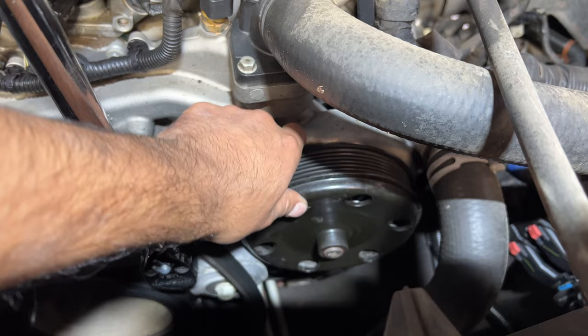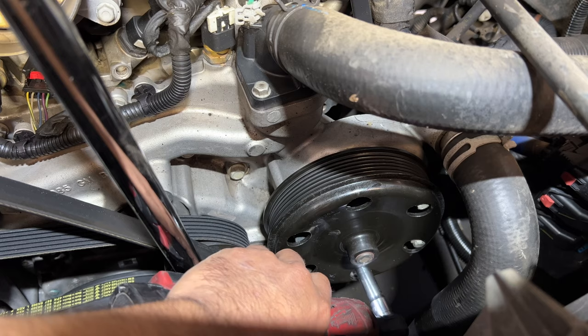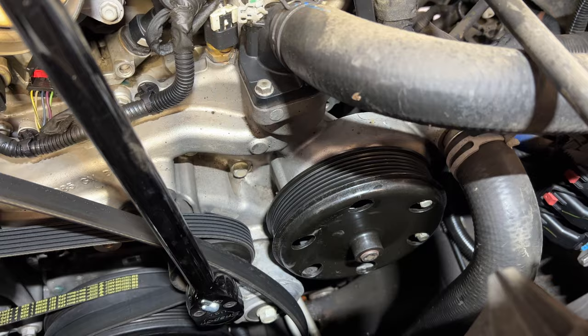You can see how much play it has, but this is one of the easiest water pumps you can do ever. It only has six bolts that hold it down. You have to kind of rotate the pump a little bit until you line them up and fit a ratchet through there. I used a power ratchet, but you can use anything — they're not even that tight. Then you can easily take it out; it just slips right off, as you can see. Obviously you're going to get some coolant falling out.